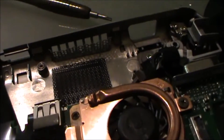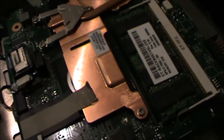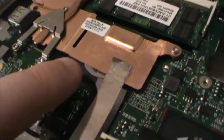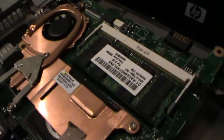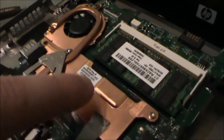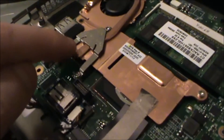This will make a huge amount of difference to the temperatures of the machine, though the machine will still run warm anyway. To be honest, I don't think the heat sink and fan assembly was really up to the task. The smaller chip is actually your video card, while this larger chip is the processor. Most of the heat generated comes from the video card, which is why it has the main pipe going down onto it. The processor doesn't generate a massive amount of heat, but the video card is definitely a problem and seems to be the more problematic chip when it comes to people having to reflow and sort that out.